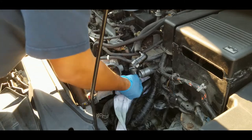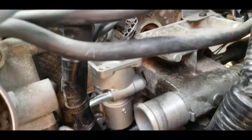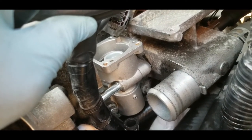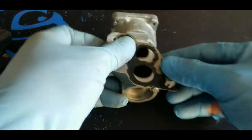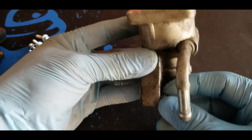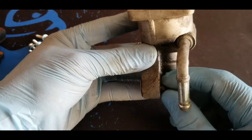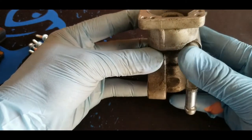But all you have to do is be patient. Otherwise, all right. So, I was able to put it back in, but it wasn't that easy. As you can see right there, it's not tightened yet, but now it's in position, and I just use my fingers to turn the bolt clockwise, just to get it as tight as I can. Alright, so how did I align it? So first I put this metal gasket, right, and then put the bolt first at the front right there, and then tighten it with my hand, just a snug, so that you can still move the EGR valve up and down.